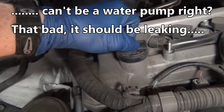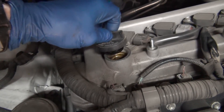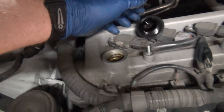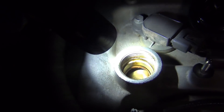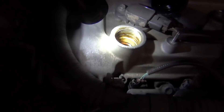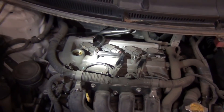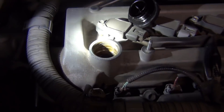This thing doesn't have too much blow-by. I might be able to get a peek at something through here, but usually there's an oil bath full. It's blowing pretty hard — this engine's pretty warm. One of the things to look at when you buy a car is see how much air is blowing past the piston rings and out through the valve cover. Pulling the cap off will reveal that pretty quick. Another thing is to look for that reddish color — that's bad. That means it hasn't had the oil changes it should have. This one probably didn't get a lot of oil changes in its early life, and then the second owner picked up the slack. You see where there's stains in the cracks and stuff? But it looks like it's better now than it's been in the past.